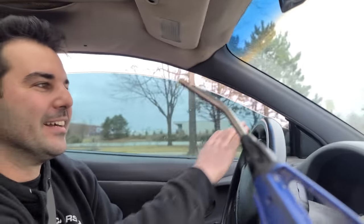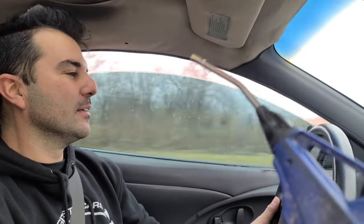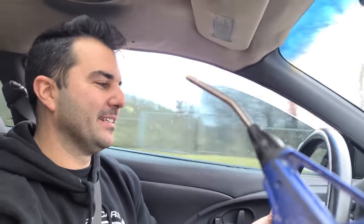I love having good wheel bearings. This car is solid. Still 10? Yeah. 10. Darn, how can we get more boost? Bigger turbo. Yeah, bigger turbo, yes. But we should be able to produce way more boost pressure with this turbo. The wastegate actuator has probably got a very, very weak spring in it.